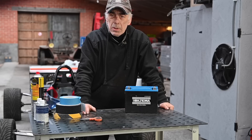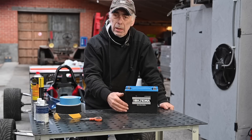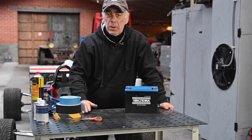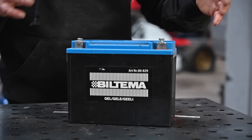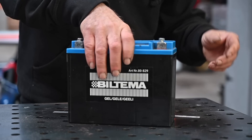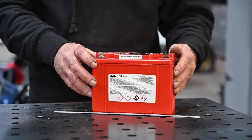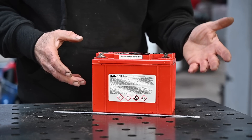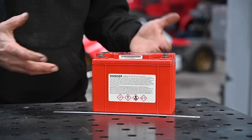In the previous episode we tried to start the car on its internal battery, which is this one right here, and that didn't work too well. I tried to charge it up but that didn't work, so that battery is basically gone. I will need to replace it, and I'm going to replace it with a smaller version. This is a gel-based battery and it delivers about 20 amp-hours, which is not a lot but more than enough for the race car to keep running.